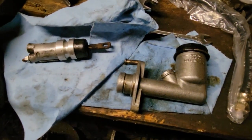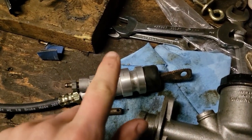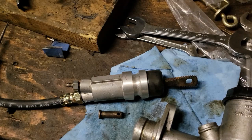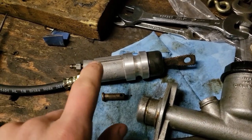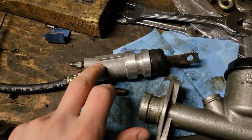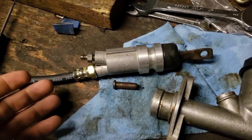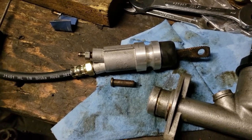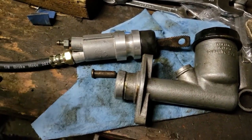Got that hose on the slave cylinder. In case anybody's looking for a slave cylinder for the early Scouts and is seeing the horrendous prices - this particular one I'm using is for a forklift. It replaces a Crown 074815 and it's the slave cylinder for the brakes. You can actually get them a bit cheaper - not a huge price difference, I probably saved like 20 bucks, but 20 bucks is 20 bucks. I'm gonna go throw this in the Scout and hopefully tomorrow afternoon I'll get the master rebuilt and we'll be driving again.